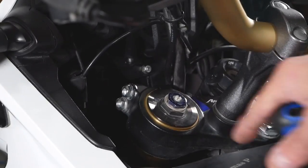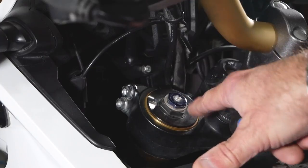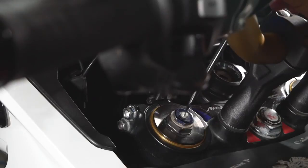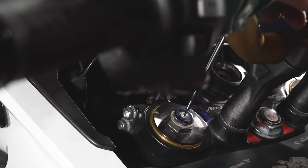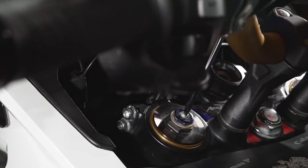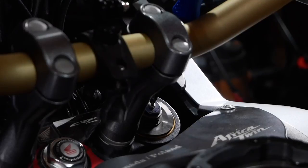Before you start, you want to release the pressure in your suspension by turning counterclockwise the center screw. I recommend counting the turns and noting it on a notepad so you have a reference when putting it back together. I'm starting with the center screw here — three and three-quarters turns on that one — and I'll do the same thing on the other side.